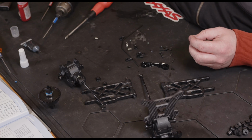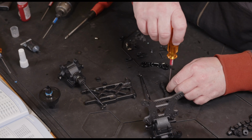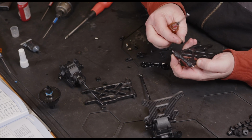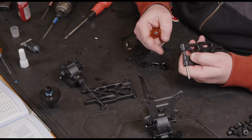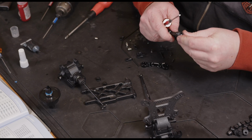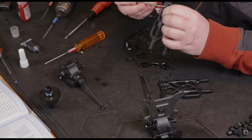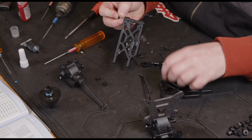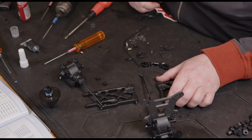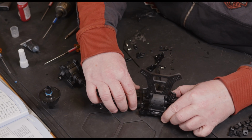You've got your 2 set screws that you're going to need to put in, and these are for the droop, and stock setup for this is 2mm. So you can either use a gauge, or you can use one of these little spacers because they're 2mm. So that's one. Right. So that's the position we're going to be in for these. They do the optional domed headed droop screws.